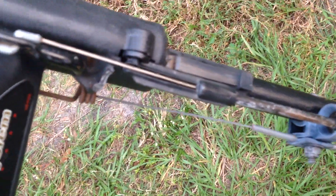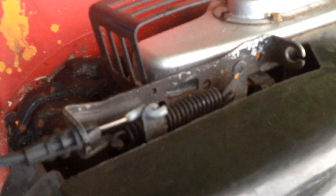The safety brake cable is working as well — usually that's the first thing to go is the safety brake cable. So it looks like just a carb clean on this one.